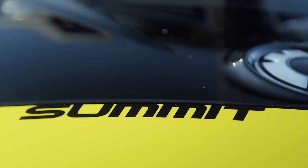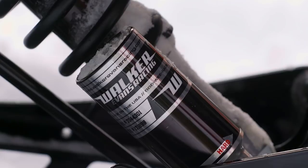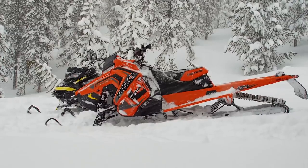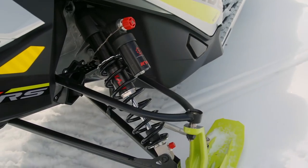In the handling area, we're going to pick the Ski-Doo as the winner — it requires less rider input and less effort, and is therefore just generally an easier mountain sled to ride. In the suspension department, things are again difficult. The Polaris has a way better shock package than the Ski-Doo, but the Ski-Doo actually rides better on rough trails. We have to decide what's more important: adjustability or ride quality. In the mountains, ride quality is much less important than having the ability to tune the sled's suspension to perform exactly how you want it to — so we're giving this one to the Polaris. If Ski-Doo would put more adjustable shocks on their high-end sleds, it probably would have won here.